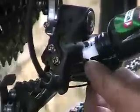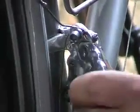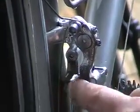Dribble lube into those places on your bike where metal rubs against metal, such as here on the rear mech. Work in the lube by operating the mech with your hands. Lube the front mech here and here and work in the lube.